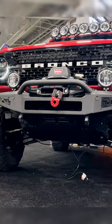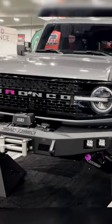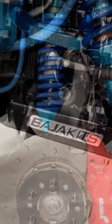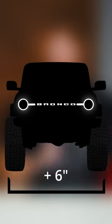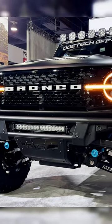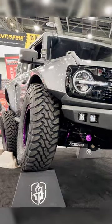This kit is actually quite a lot of bang for the buck. It's going to cost you about $10,000 to do it, which is a lot of money, but it includes an upper control arm and a front lower control arm as well as axle extensions, and that's going to widen your Bronco by three inches on each side, widening your track by six inches total and giving you a significant gain in overall wheel travel as well.